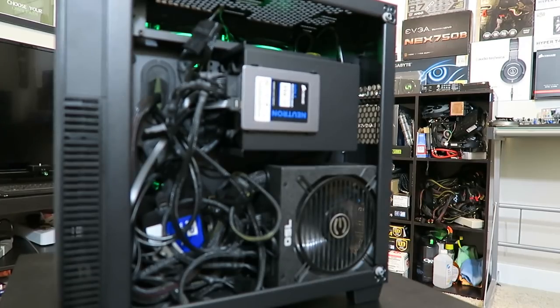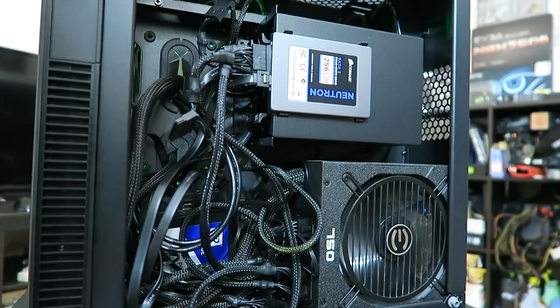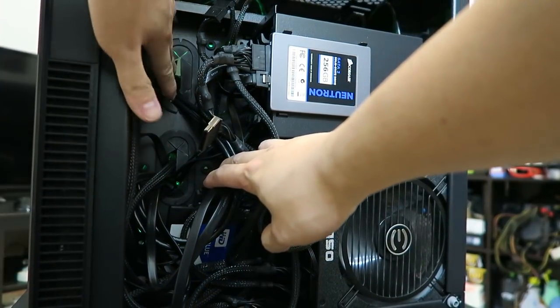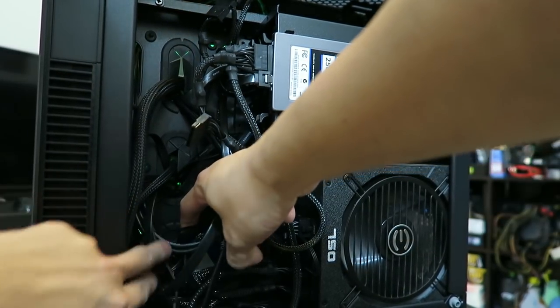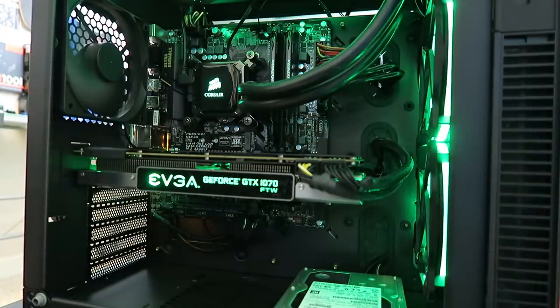I love cube cases for the sole fact that you don't have to spend too much time with cable management. The separation of the chambers allows you to be really lazy with it because the other side is almost never seen. I opted not to mount my second SSD since I wanted to use all three of the grommeted holes — it's kind of just floating in the wires, but this side of the case won't be showing anyway. Since it's an SSD I don't have to worry too much about vibration or shock damage. It's not the most ideal solution, but it works and you'd never know unless I showed you.